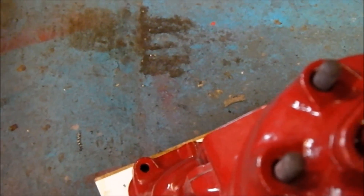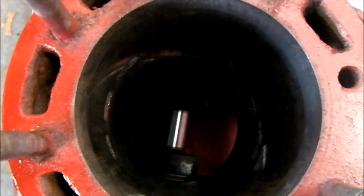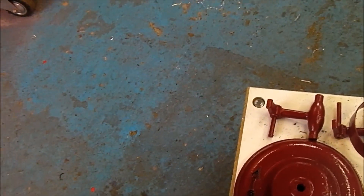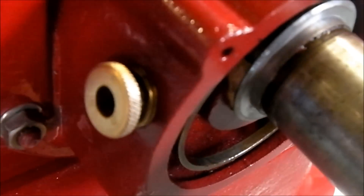I'll give you a look inside the cylinder if I can get the head off. That's the back of the cylinder head and that's inside the barrel. I also made new bearings — or my dad made new bearings, because I, to be honest, don't have the skills to make bearings on a lathe. You might just be able to see them in there behind the oil thrower ring. I made them from bronze rather than white metal.